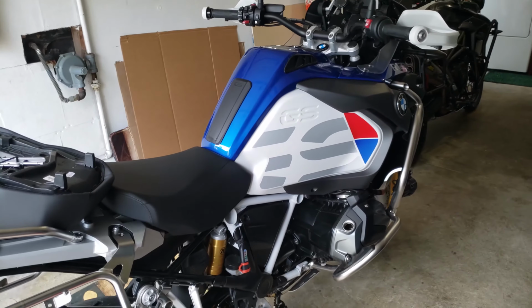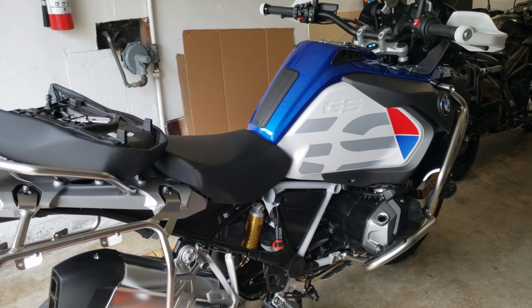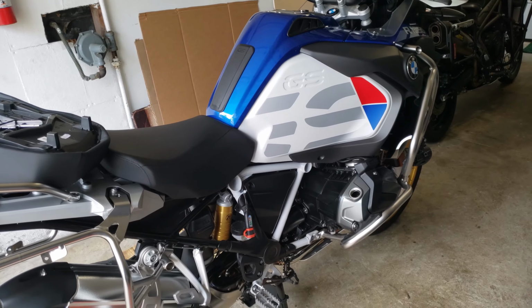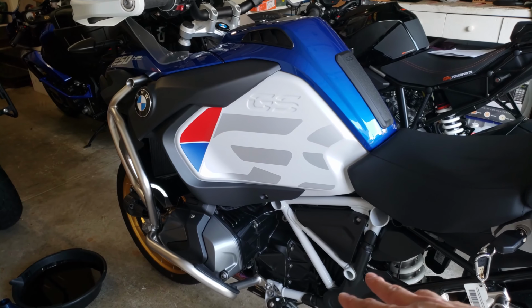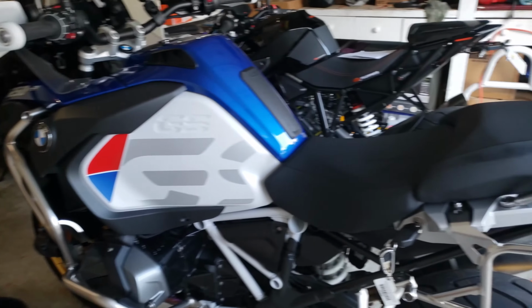So, but basically that's it. That's the oil change for the R1200, R1250GS, GSA. I thank you guys for watching, and I'll see you guys on the next one. So torque the drain bolt to 24 foot-pounds, 8 foot-pounds for the oil filter, and you're good to go.